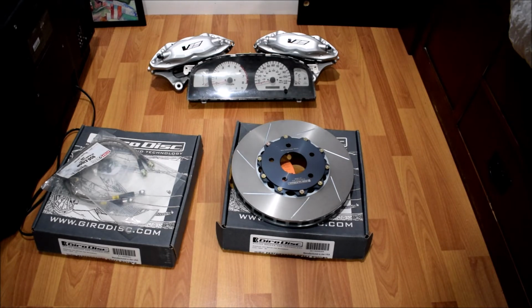The only downside is my truck has a cable-driven speedometer instead of an electrical-driven speedometer, so I have to make a conversion there. And also, although the plugs from the harness are exactly the same, these are wired completely differently. So I have to mess with the wiring diagrams for both trucks in order to get that to work properly in my truck.